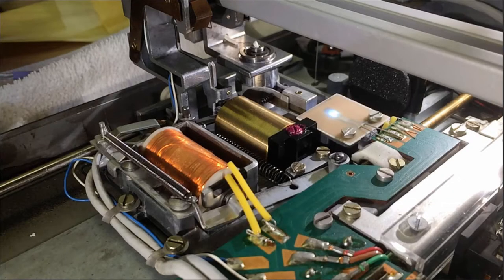First I want to discuss the mechanism. Here you see the solenoid that activates the tonearm lowering process, and this here is the damper that slows it down. The damper is connected with this arm to this slider, and this slider here is blocked by this arm that is activated by the solenoid.